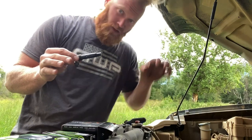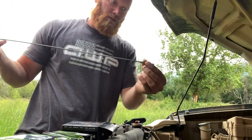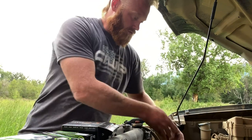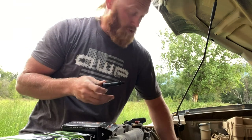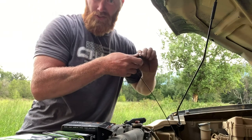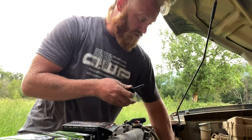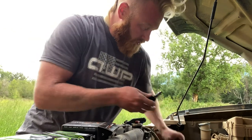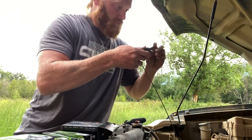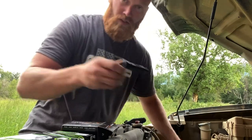Here's a little technique if you don't have any used oil laying around: get your dipstick, just get a little bit on your finger. You might have to do it two or three times. It's not new oil — well, brand new oil — but I did an oil change just a little bit ago, probably 500 miles ago, so it's still relatively new. I don't have any actually used oil, so just dip it in there a few times and make sure you coat the O-ring.